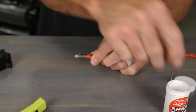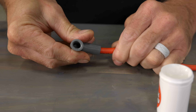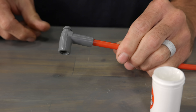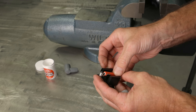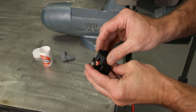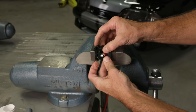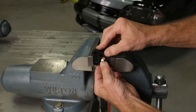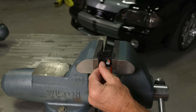Or if you haven't installed a boot yet, apply some dielectric grease to the terminal and wire and slide the boot onto the wire and you're done. If you're using the vice style crimping tool, place the assembled wire and terminal into the tool, then position the other half of the tool on top of the wire. Next position the tool in a vise, making sure the tool is properly positioned and is flush with the jaws of the vise. Tighten the vise until the mating pieces of the tool butt up, then release.